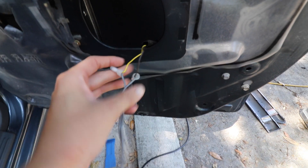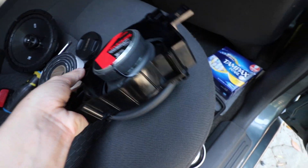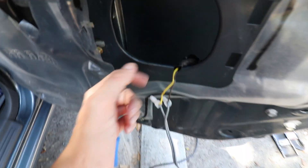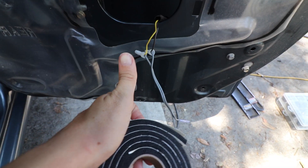While I'm here, I'm going to be replacing these speakers. I'm doing six-and-a-half inch Kicker KS series. There were actually Kicker CS series in here — the cheaper version — and I just don't like them very much, so I had some laying around and I'm going to replace those. Also going to do the connections a little better. We noticed last night that the speakers were rattling when the bass hits, because this box here is just hitting the metal. So we got a gasket we're going to put around where the box sits and hopefully that'll solve the problem.